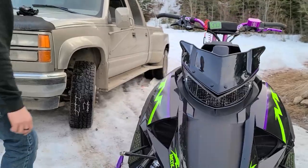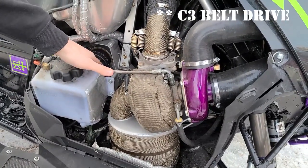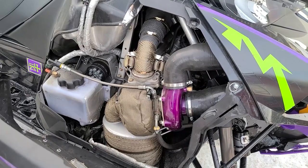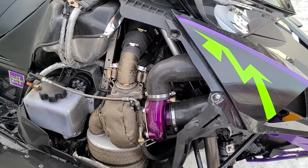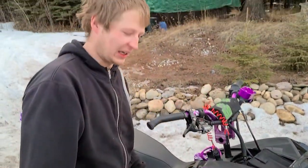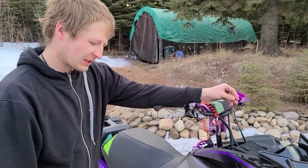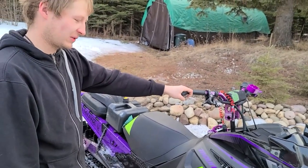Over here is the crème de la crème. It also has the TKI belt drive kit in it. But this is the reason this sled is owned now — that is a Silber turbo. So we finally have a turbo in the fleet again, one that works. Silber's turbo kit is all set-and-forget, so it's actually a decent kit — there's no fuel controller. It's remapped in the ECU, so you don't have to worry about anything on it. I think it's running at around a little less than 200 horsepower.